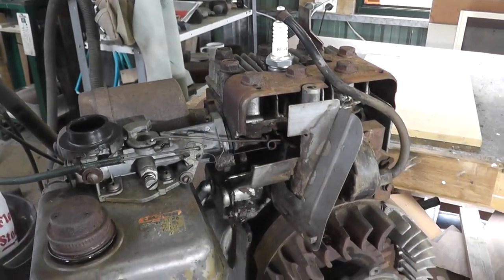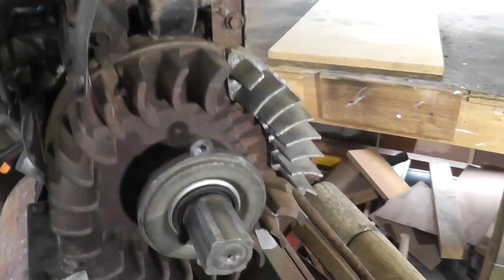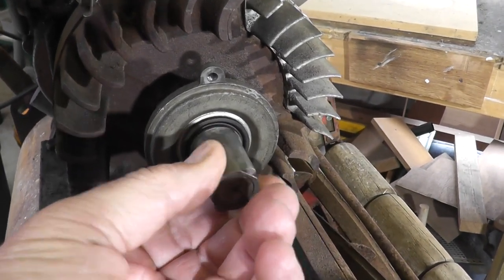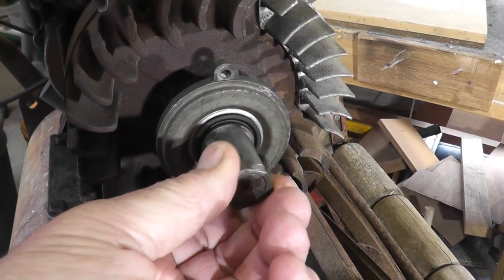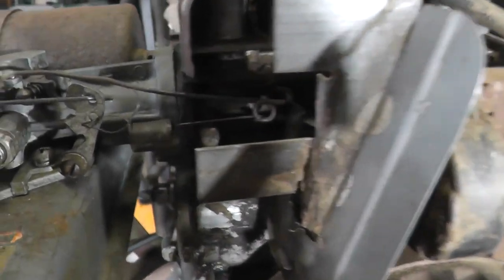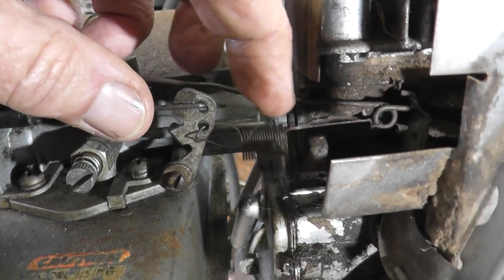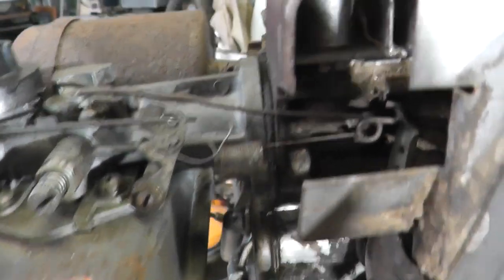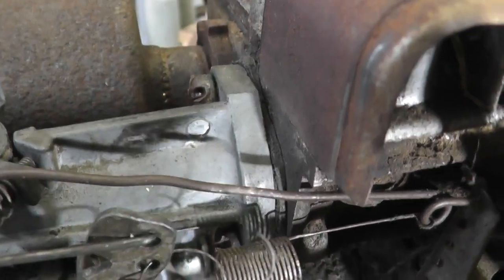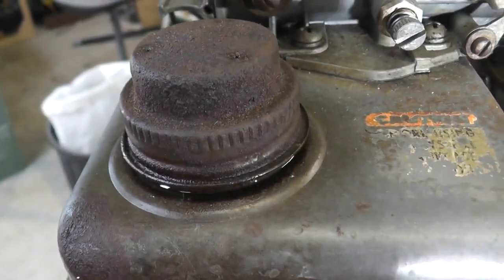This isn't going to be a full restoration — I'm just going to get this running. I'm going to have to take this apart. It sometimes catches because it's got some gunk in it, and I'll show how you do that on a video. This governor spring here is quite obviously knackered — it's been re-stretched and put back on. Those screws holding that manifold on are loose, and it's also leaking a bit, so I'm going to have to fix that.